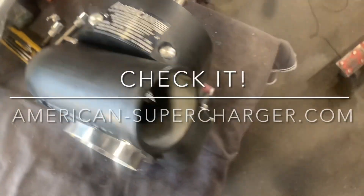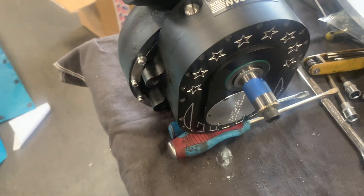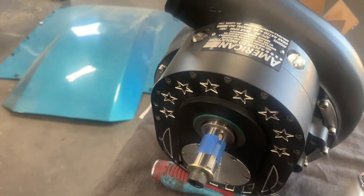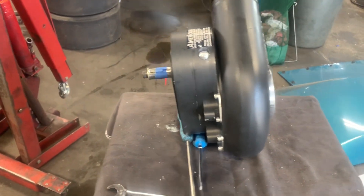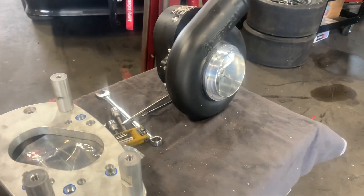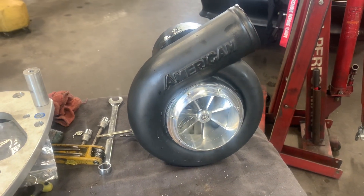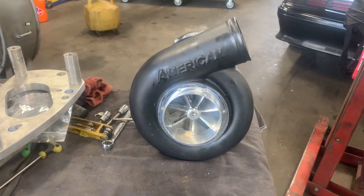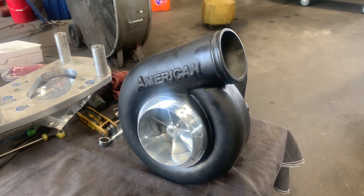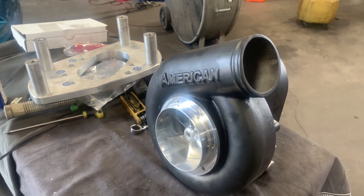This is the part of the video you've all been waiting for — the new American Force Induction AF 194. It's a 94 millimeter inlet, 4.14 step-up ratio, 78,000 RPM max. Ryan and Dan are telling me this thing is going to really surprise me on how much mid-range it makes and the average power. It bolts into competitive brackets as an upgrade. They've used it in drift cars, so we know it's durable. Today we're going to spin it up on the 358 and see what kind of power she puts down.